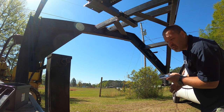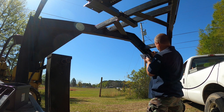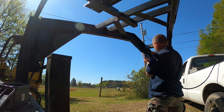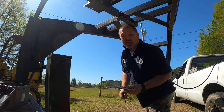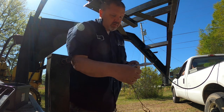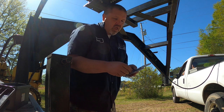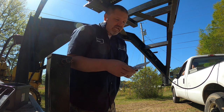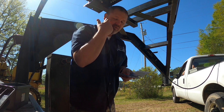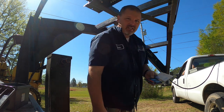Hit the brakes, let off, hit left turn signal. That's where a test light doesn't help you — you need either a really good multimeter where you can select retain high. I gotta get back here in the back and see if it's a bad connection or a bad bulb. It's hard to see what I'm doing way up under this trailer.